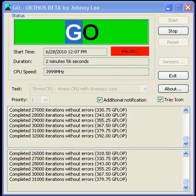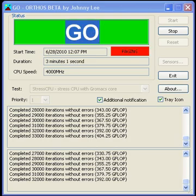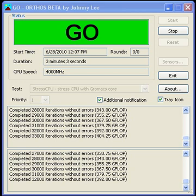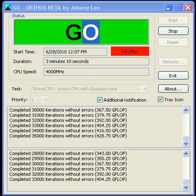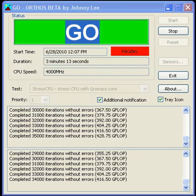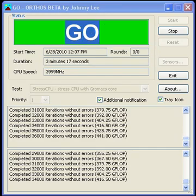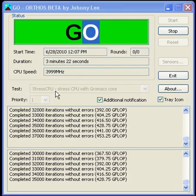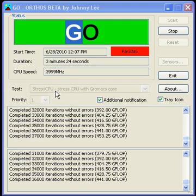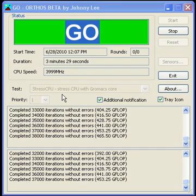The program remains in your taskbar and it also includes sensor readings, but I don't know if it really shows those readings. I never went through 80,000 iterations of small FFTs yet, but you could try it and tell me how it is. It seems to take too long for one CPU with two logical cores, which would be my hyper-threading-enabled Pentium 4 in this case. Priority goes from 1 to 9, but don't choose 10, because that will make it real-time and devote every available CPU cycle to it, completely throttling all your other tasks. Even the mouse cursor will skip about every second or so.